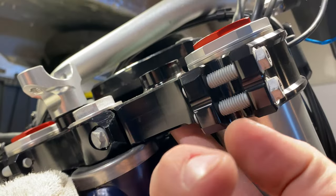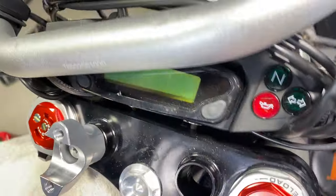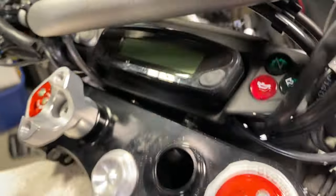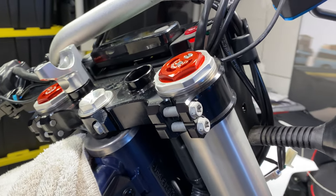The bottom won't come out unless you loosen up the bolts that are holding this piece in, which are those T30s that are under here. Once you loosen those up, this will move forward enough for you to drop this out. Let's do the other side.